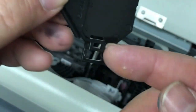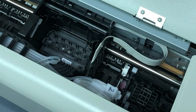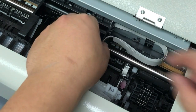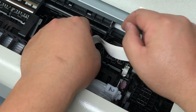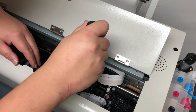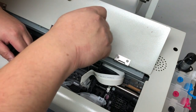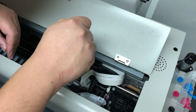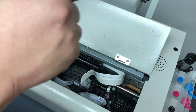You can see here's the lower tab and here's the top tab. Now we can take the cable out of that loop. You're going to see three screws on the printhead — just use a screwdriver and remove all screws. Save the screws in a safe place because they're pretty hard to find.